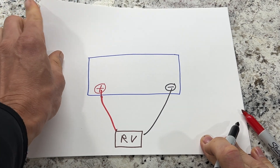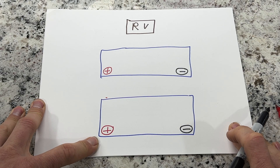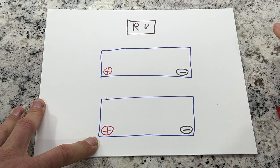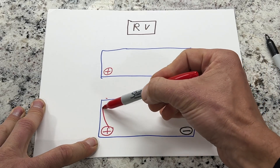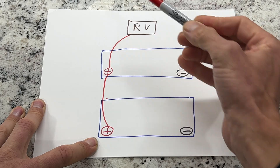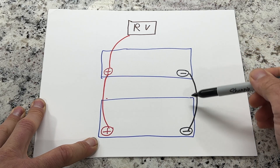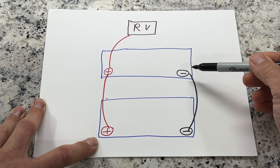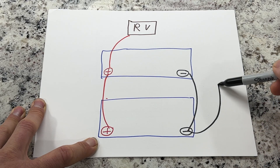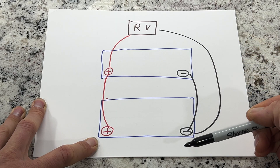Now let's go to a two-battery setup. We're going to connect our batteries in parallel — we have a 12-volt battery and a 12-volt battery, and we'll need 12 volts for the RV. Positive to positive, and that positive will go to the RV. Our negatives will connect negative to negative. Now the batteries are in parallel. Instead of going from just one terminal, we want to balance the batteries, so we'll go from the second battery to the RV. Now it's getting 12 volts from the batteries and the two-battery bank is balanced.